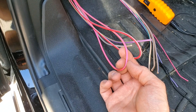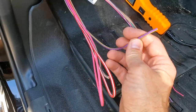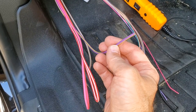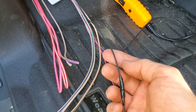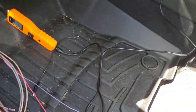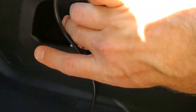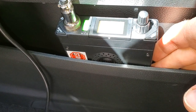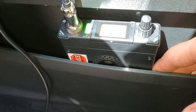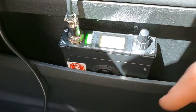If the radios get annoying and I want to just kill them, I don't have to reach both radio knobs separately — I just hit a button and it kills both. I'm going to feed this under the dash to probably aux five or six. This black wire is a good ground. I've got my President Bill radio here. It actually fit really well down in this pocket, but once I plugged in the antenna it makes it sit higher up. It sits a little bit high, so I might move it to the outside or down into the center console.